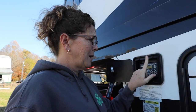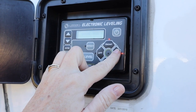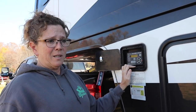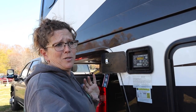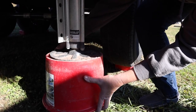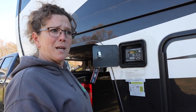Now we're gonna check and see what change that made. The front probably isn't going to show any change, but the right was at 3.5 — now it's only off by 1.6, so still a little bit. The levelers can only be but so big. The front is still low, and just like I said earlier, if the front needs to come down you can't put the buckets there. The same applies to the next two jacks on the side — since this side is gonna be lower you may or may not have room to put your buckets under there. If they won't fit, they won't fit — you just don't need them. In this instance we'll probably put the buckets on the other side and not worry about this side, because that side needs to come up and I want more stability over there. We're gonna run through the rest of the process, get it off the truck with the level button, then check everything out.